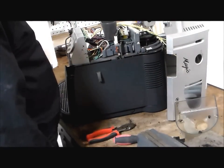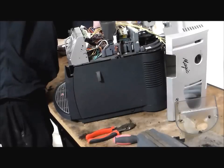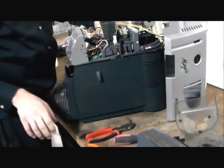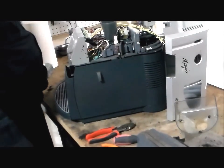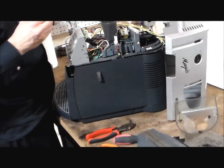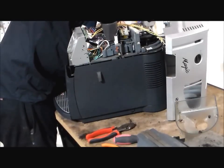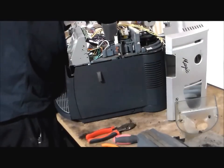So we're going to go ahead and change out these O-rings and hopefully that will be the full source of her leak. However, sometimes what happens is there becomes more pressure inside the boiler, and then the boiler also starts to leak because the boiler is a clamshell style, and essentially that O-ring over time dry rots just like every other O-ring does.